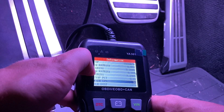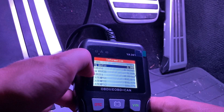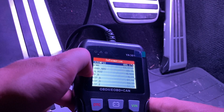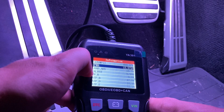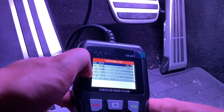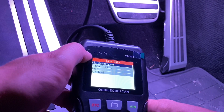There are a bunch of things you can monitor if you have some kind of issues. Look at that — the catalytic converter temperature is already up to 495 degrees. They heat up quickly — I know because I got burned firsthand from these catalytic converters because they get super hot. That all data stream feature is super sweet.